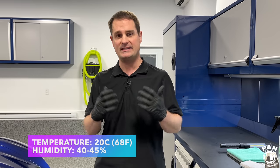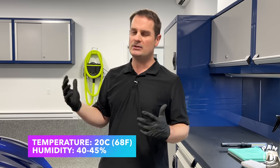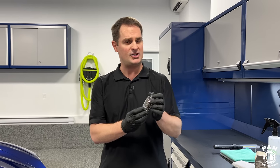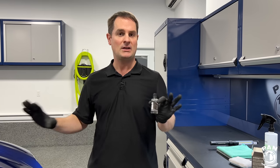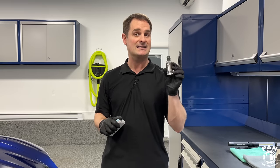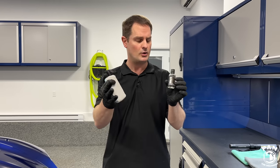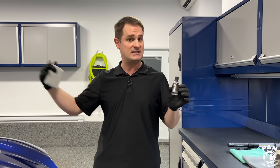I'm working in my garage at 20 degrees Celsius or 68 degrees Fahrenheit — those are optimal conditions. If you work outside, always work on a cool surface. Do not work in direct sunlight, and I wouldn't go below 50 degrees Fahrenheit or 10 degrees Celsius. The coating has a relatively quick flashing time of roughly 60 seconds when applied to the surface. Work in smaller two-foot by two-foot sections until you're familiar with the product. They recommend two coats with one hour between coats for maximum durability of one to two years.